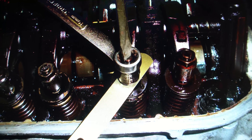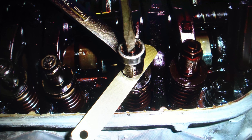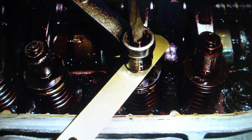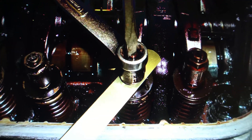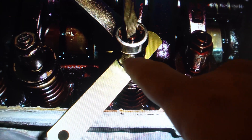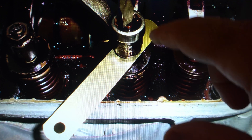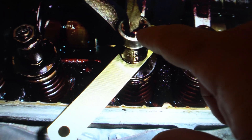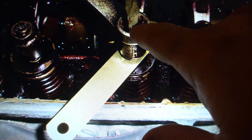So this is a Honda engine, and Honda used a similar system to ours — it's really exactly how we do ours. You basically have the valve stem here. This is the feeler gauge; ours is 0.1 millimeter. This is the rocker arm. There's a nut here and then an adjusting screw. Loosening and tightening this one adjusts your clearance, and then this locks it down — 10 millimeter.